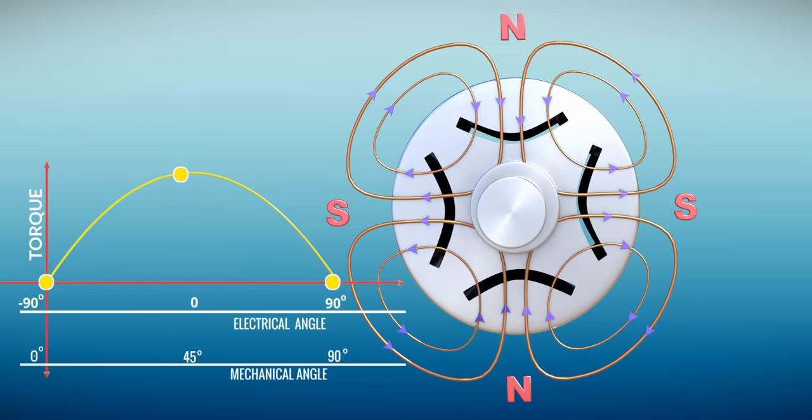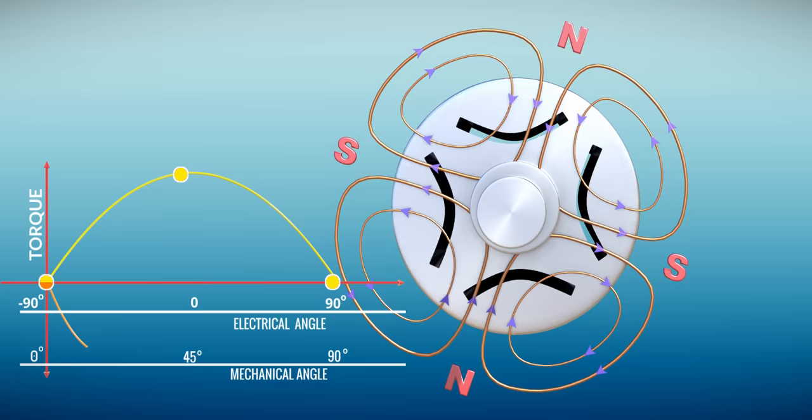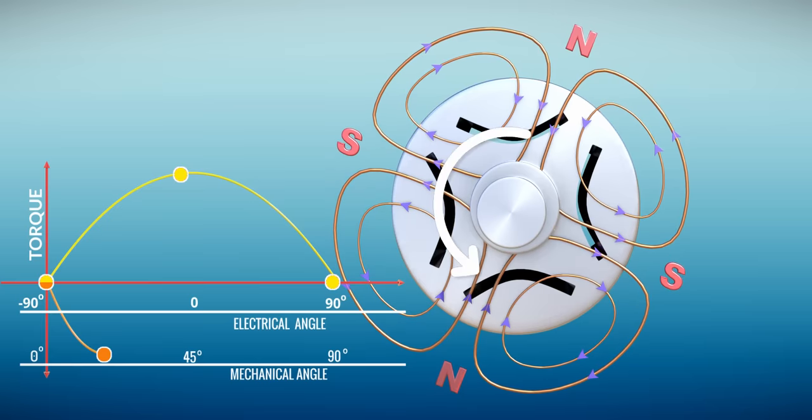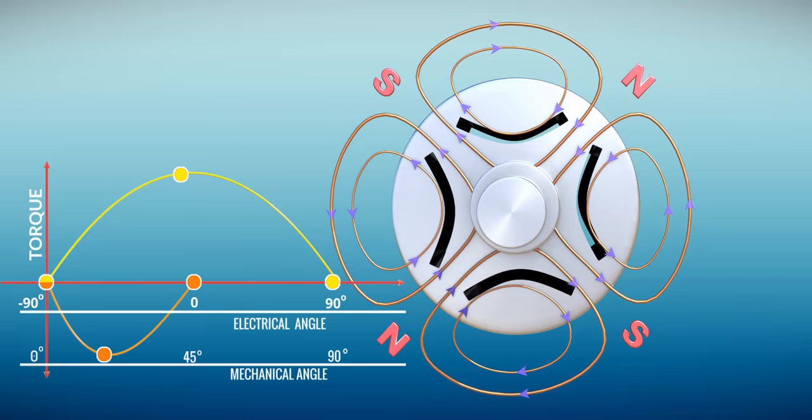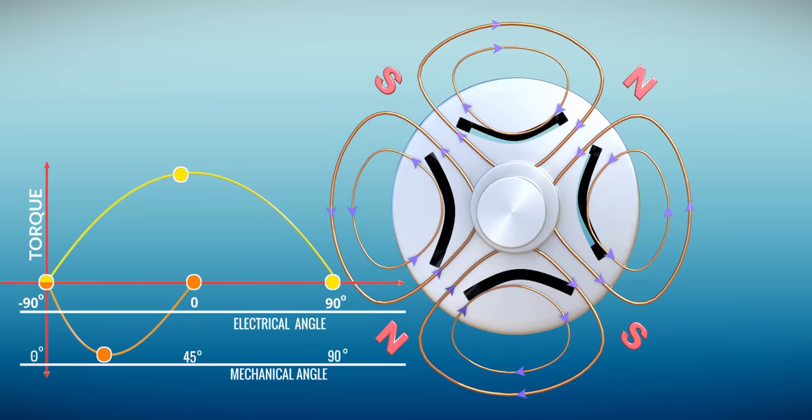The iron part of the rotor has an opposite effect. At the initial angle, torque production is zero because it's a perfectly misaligned and symmetrical case. When the RMF is slightly offset in a clockwise direction, the rotor experiences negative and maximum torque. As the RMF reaches 45 degrees, the torque becomes zero again. As we further rotate the RMF, the reluctance torque produced becomes positive. Analyzing the Tesla Model 3's combined permanent magnet and reluctance effects together, it's clear from the total torque graph that if the RMF angle is around 50 degrees, we get maximum torque. Tesla engineers ensure that when you start the car, the RMF angle is around 50 degrees to guarantee maximum torque production.